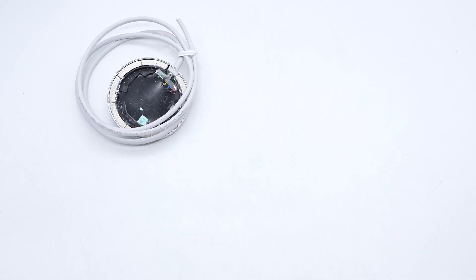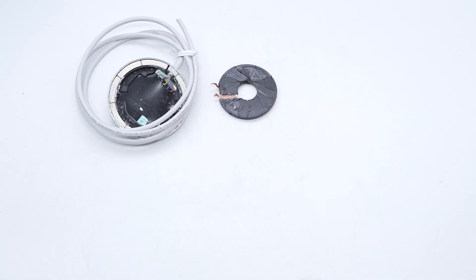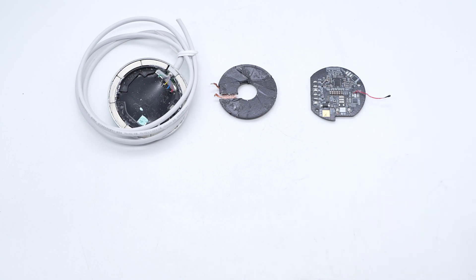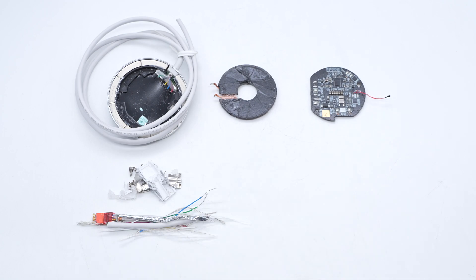Those are all the components of the Xiaomi 30-watt magnetic wireless charger. It comes with a USB-C cable and an aluminum alloy casing, uses a magnetic design, and the experience of charging and using simultaneously is good. After taking it apart, we found it adopts the NuVolta NV1708A wireless charging solution, which is a highly integrated wireless charging transmitter chip with an internal MCU and wireless charging power stage. The wireless charging coil, magnets, etc. are glued, reinforced, and insulated.